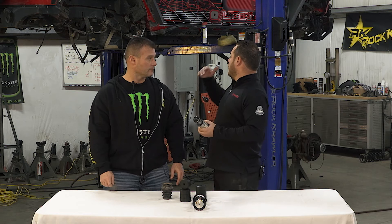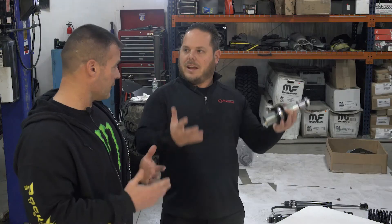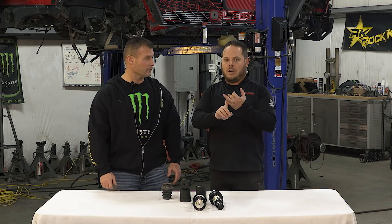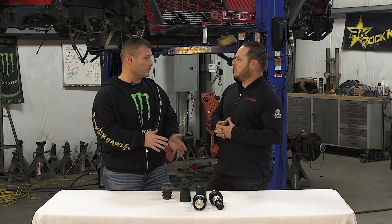You always want to dial in the vehicle. Once we get the axles back in with no springs and no shocks, we're going to push the axle all the way up, drop one side while stuffing the other — that's how you get the clearances and set the bump stops. Throw the wheels and tires on, articulate it, and find out when the first thing hits — that's where you set your bump stop. Then put your shocks in to make sure you're not going to hard bottom on the shocks before engaging your bump stops, because you don't want to drive through your shocks — that'll blow them out.